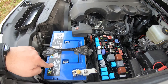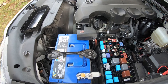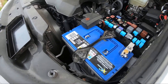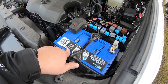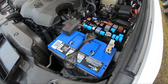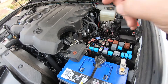The way AGM batteries work is something like — they lose 50% of their storage if they're not charged all the way up. So it's that last few volts, or last half a volt or so, that really puts the storage in these things. Last time after it sat for a night I was at 11.9, maybe 12 volts the next morning after 12 hours. I'll try to check this again and see if there's any change.